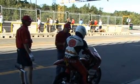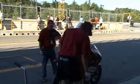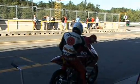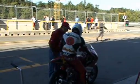Even though the tyre warmers had been on the 426, the motor was still cold, so we had to spend a minute or two getting it up to temperature. The worst thing you can do now is go out on a cold engine and try and put some fast laps on, so we had to get the temperature up a little bit.